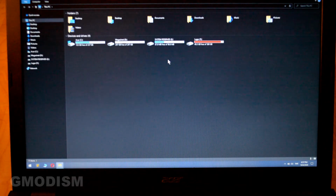And there we successfully booted up our PC. And if you have problems booting, you might need to go into BIOS. On screen when you start your computer, it prompts you to press a special key to get into BIOS, and you go in there and you change the boot order. If you, for example, have an old Windows install or something on one of the hard drives you inserted and you haven't cleaned the drive prior to installing them, like we did in this video, then you'll just change the boot order and you'll need to do what we did earlier with cleaning the drives afterwards, if you have an operating system on those drives already.